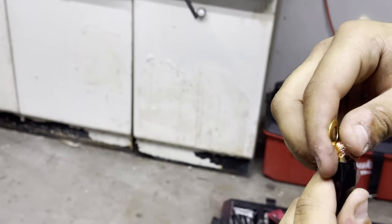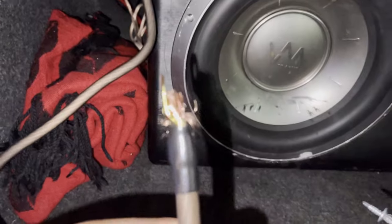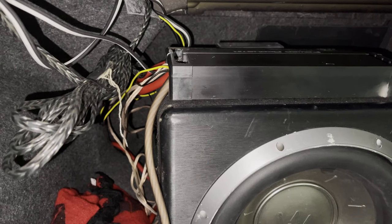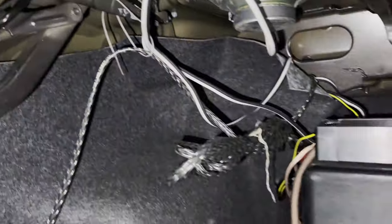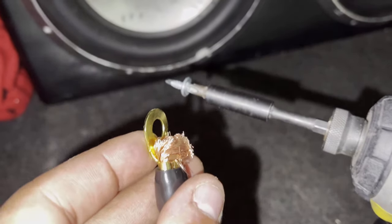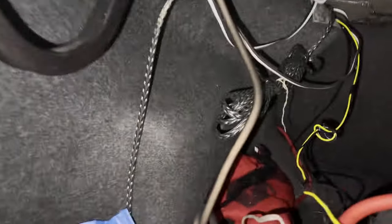Once we get the ground connected, the reason I put that piece on is that I'm mounting this to the frame — it has to be connected to metal. Coming up under here there is my frame behind the trunk, and I'm just going to screw right into that with the self-tapping screw that was supplied. Literally through that hole — boom. That's all I need.